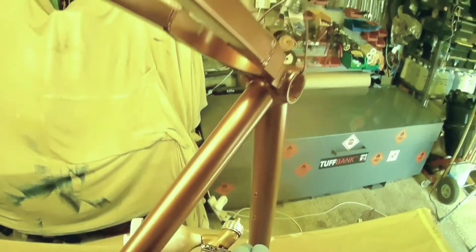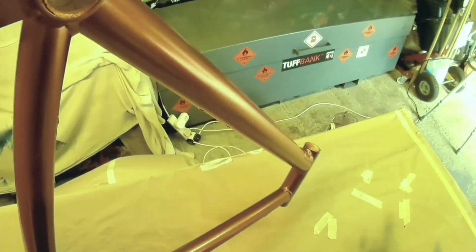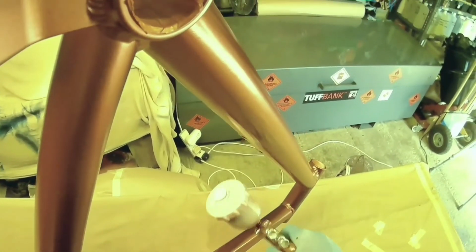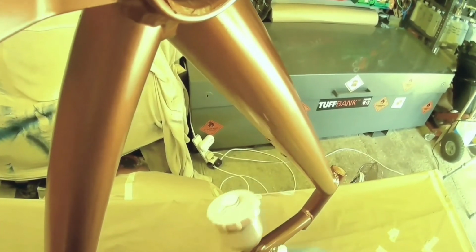If you do get to a stage where you do the base coat like this, and you're not well or something like that, so there's a reason why you can't do it, then go over it with something like a grey Scotch-Brite, and be really careful, because you can make marks on paint that you actually see when you lacquer. So just go over it with a grey Scotch-Brite and be really careful, and that will give something for the lacquer to adhere to.